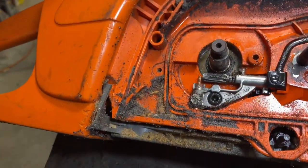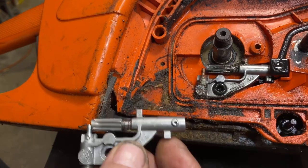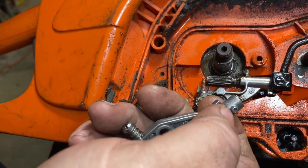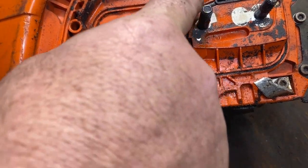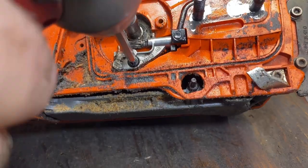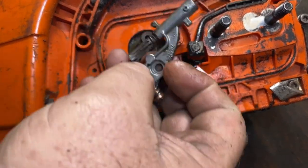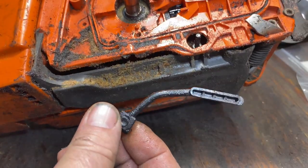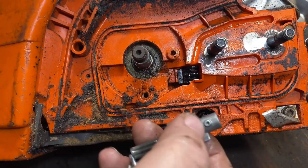So let me give you a basic explanation of what you're looking at here. This is the new oiler that fits in like this. This part fits underneath this grommet, and that's where the oil is fed - you see that hole? There's a hole on the other side, and you'll see it when we take this out. There's another grommet and hose that goes into the oiler tank underneath that lines up with it. When we take this screw out, we should be able to pull all this out in one piece. We'll inspect our hose, and if it's good, we'll go back with the same hose. So remove this screw and then we'll remove our oiler - it should just lift out. That's our bad oiler. And that's our oil supply - this is how it gets to the bar. There's a little hole in that grommet; that is what that other hole slides into to make it draw the oil.